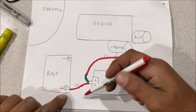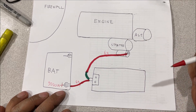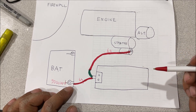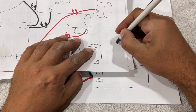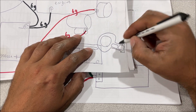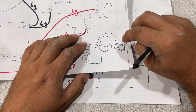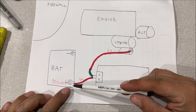On some BMWs, Audis, or Lamborghinis they do have fuses from the factory at the positive battery terminal — some batteries can be 900 cold cranking amps. What are you going to do, put a 900 amp fuse there? That thing would never pop. On some higher-end cars you'll see a 150-amp breaker or fuse there. No vehicle I own — even my 2017 Camaro or 2017 Tacoma — has any fuse at the battery terminal. On later model vehicles the battery terminals seem to have hollow weak points in them that melt first when things heat up.